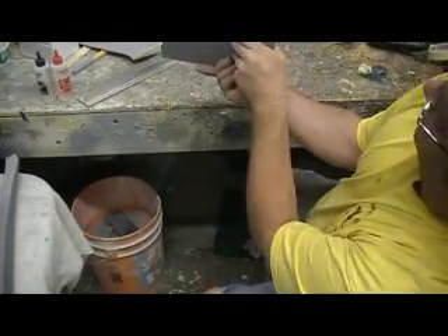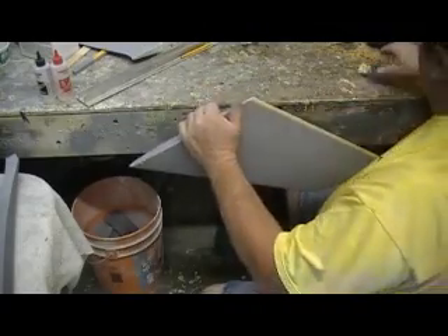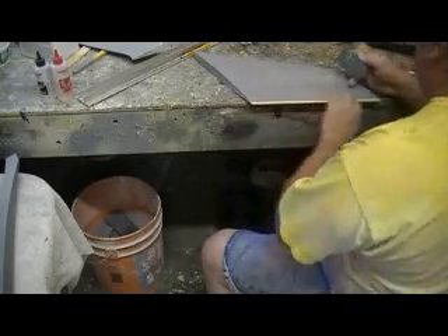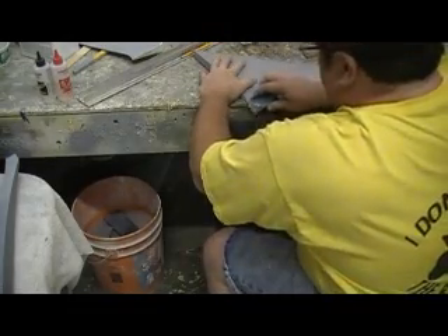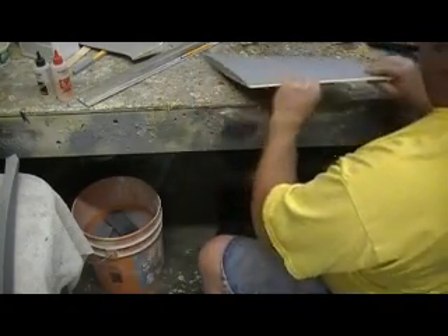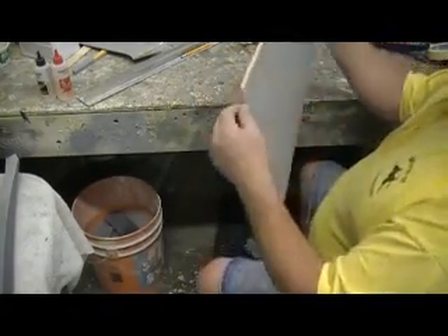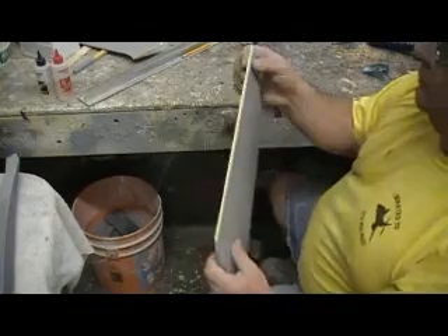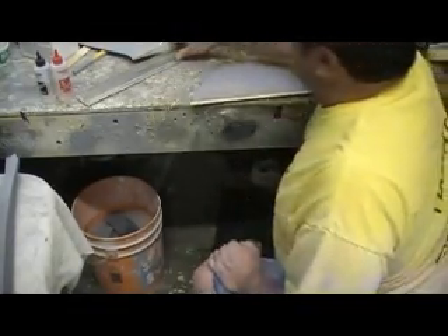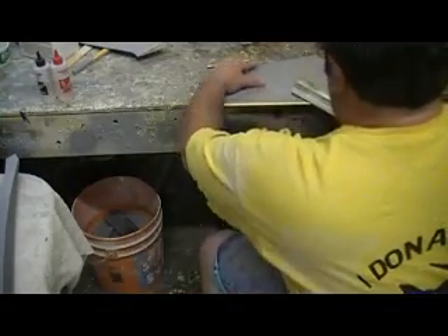That plane gets that thing nice and straight. You eyeball it, get any high spots out. It's a little lighter right there but it's got to come down a little. Bam, that's a lot better. Now once I sand that, that would be nice. I'm going to use my 36 grit, get out some of the fill to do, prime. When we get this to where one more coat of primer will do it.